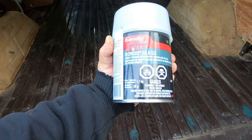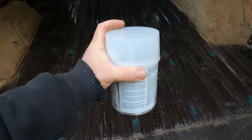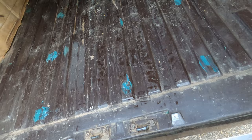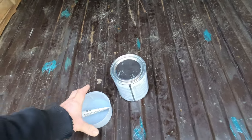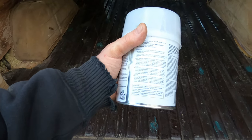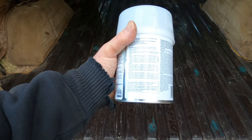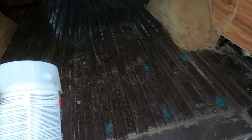But yeah, it's a short strands of reinforced fiberglass filler. Works good. You mix her up, your hardeners in the top. I try to keep it all clean so you can just put it all back together again to use for next time. Takes 3 or 4 minutes to start hardening. After 12 to 15 minutes, you can file the excess amount off. But I'm just gonna leave it overnight.